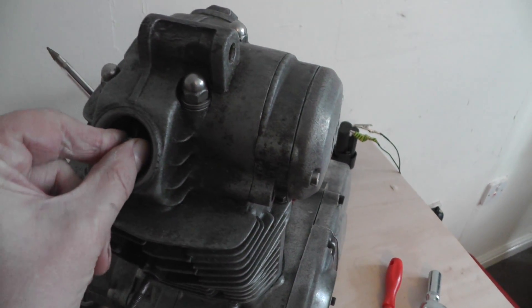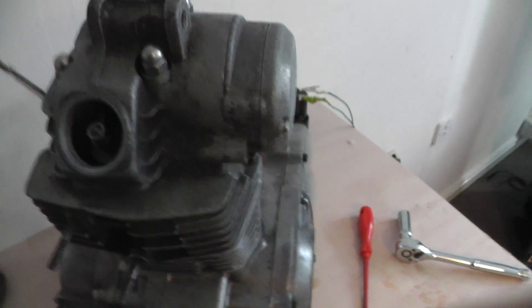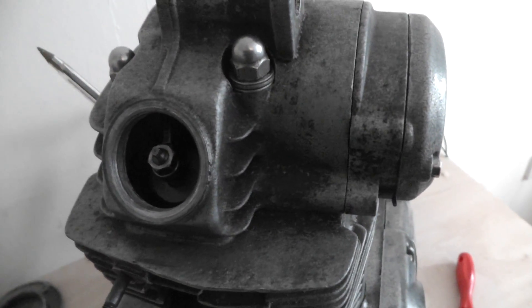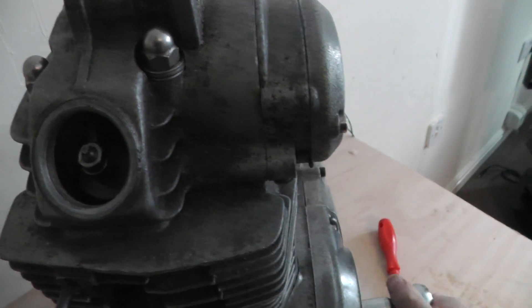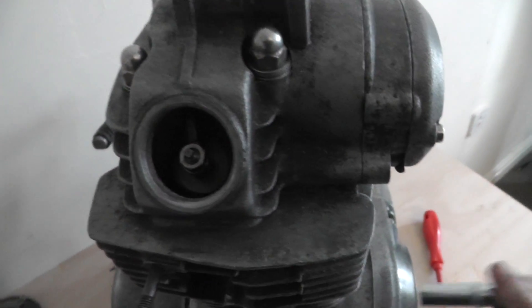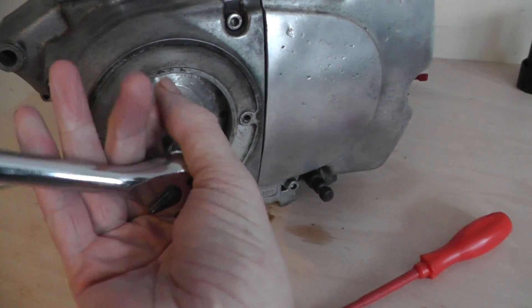Because basically it's on the flat — if I show you, I'll just do it. You turn it either way and the valve starts to go down, you see the piston moving, the valve starts to turn and operate. You've also got timing marks at the bottom, so if I go back...